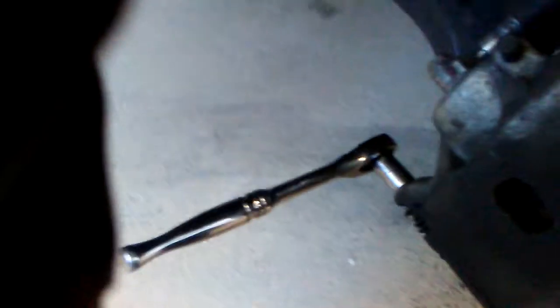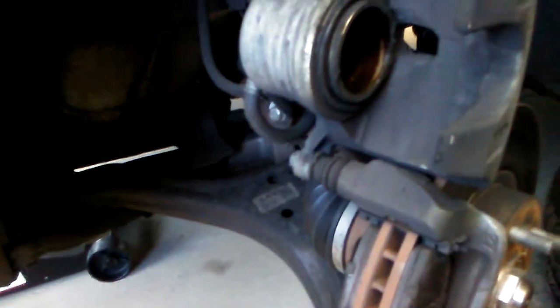Get the right size socket on there, which is a 12mm. Put it in reverse and go ahead and take that bottom screw out — boom, get that bottom screw out and the whole assembly swings right up. Now I noticed I didn't get the piston all the way flush, so I'll put the bolt back in and pry it some more before installing the new brake pads. Alright, now I've got it nice and flush with the caliper.